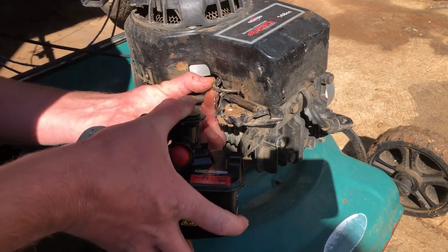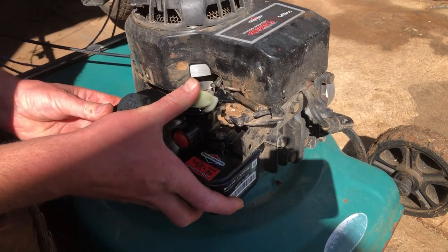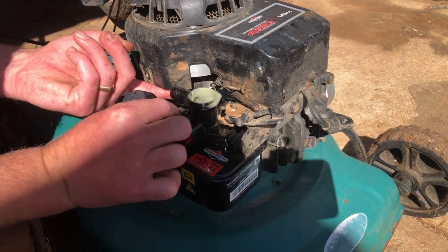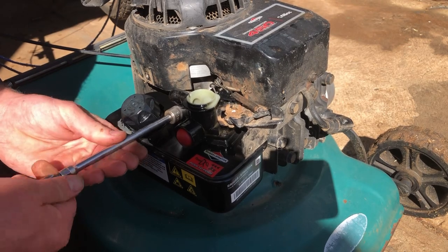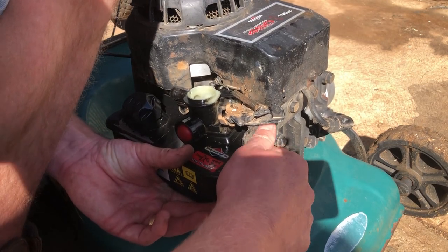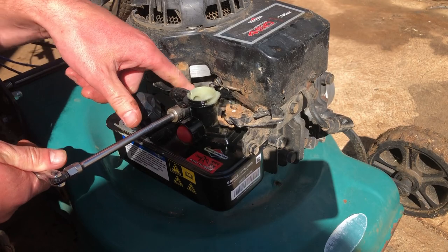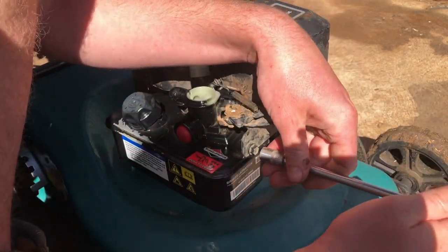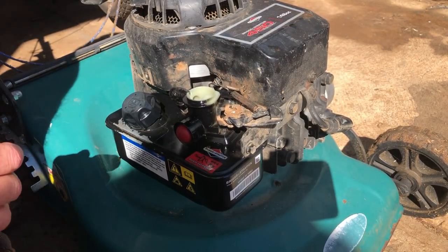All right, carburetor. And I'll put our bolts. There's one bolt. As usual, don't tighten this one right up until you've got the other one started. Saves breaking stuff. Right. Don't forget your little spacer that goes in here. Sometimes it falls out. There's one. Two. What's our throttle cable like? It's sort of twisted around a bit.